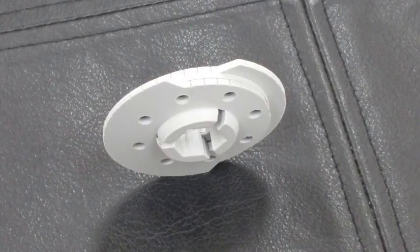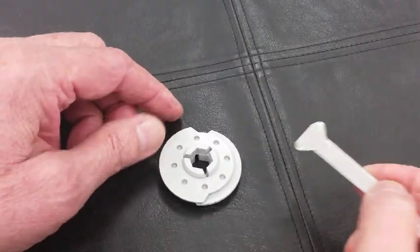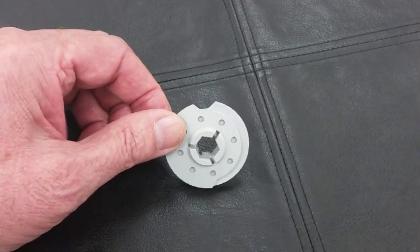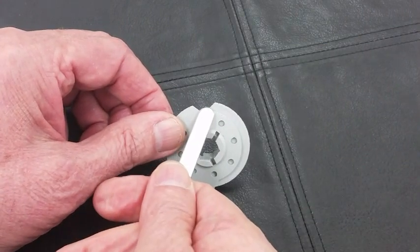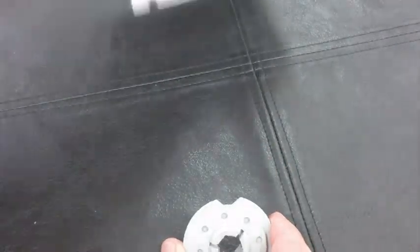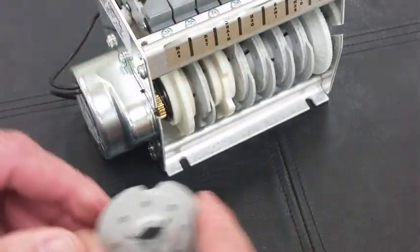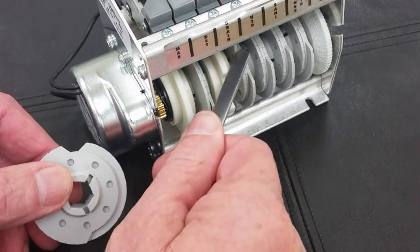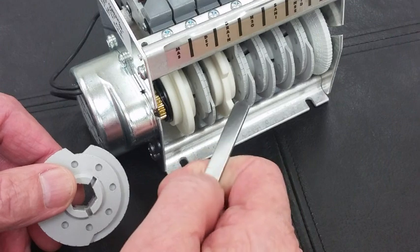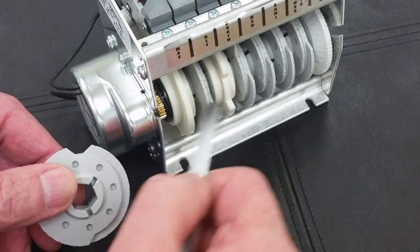The plastic cams are the same, only smaller. By moving the two cam wheels with a cam tool, we can lengthen out the notch or close it up. On the cam timer, this gives us a longer or shorter duration of a switch being closed.